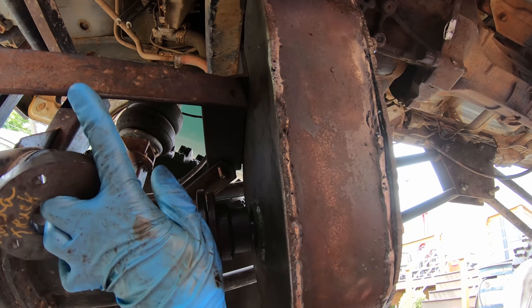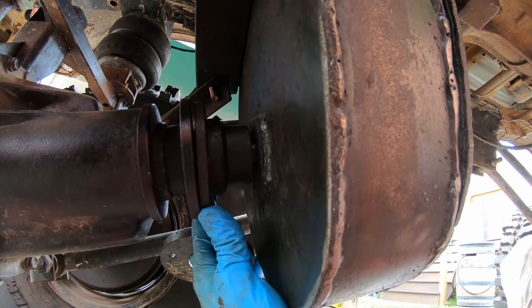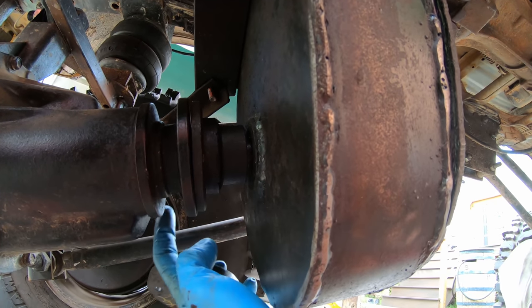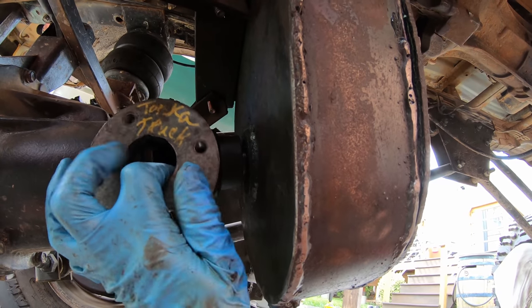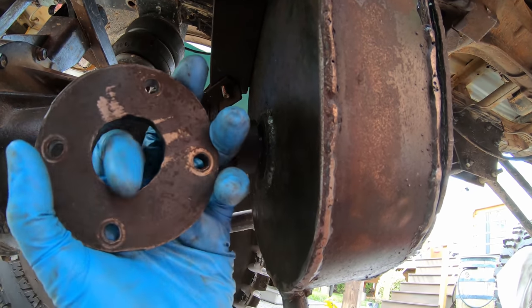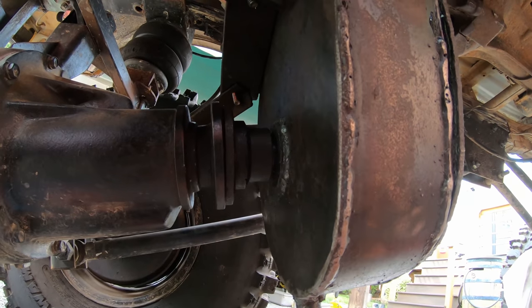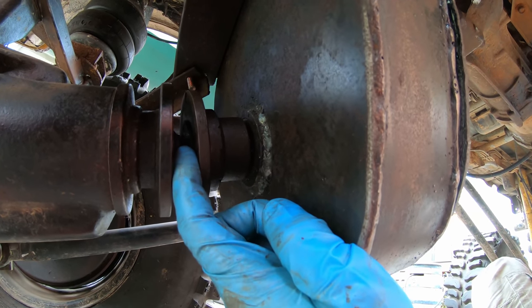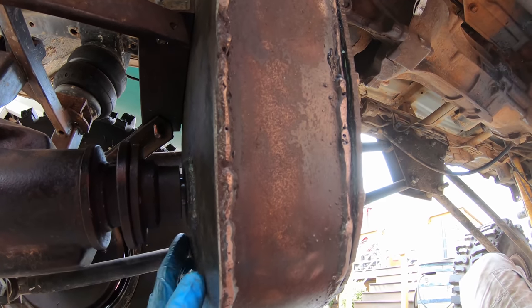With the gear case hanging on the top brackets, we can see the alignment on the companion flange is off pretty hardcore. It has to come out, oh, I don't know, about 1/8 of an inch to make that gap even. And so when I took it apart, somebody had this spacer made for it. Tonka truck, it says, and the holes were totally whacked out and crazy, but it was on there, but the center hole was not even big enough for the center little piece on the gear case side, you know, that ring in the center. So it was really cattywampus, we'll call it.